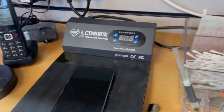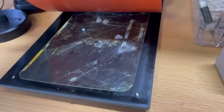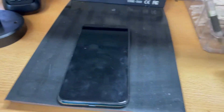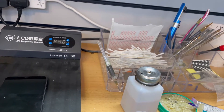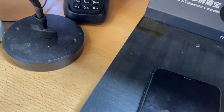Continuing with the video — we got up to 220 degrees. Look, it was very hot underneath; the glass cracked. However it's cooled down, still a little bit warm. Let's test it. I'm turning it on — it may give a warning that it's still hot. The SIM card was on top of the heater, so let's put it back in. Honestly, this is not a proper repair — this is a cheat repair.